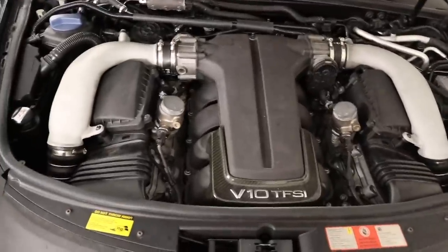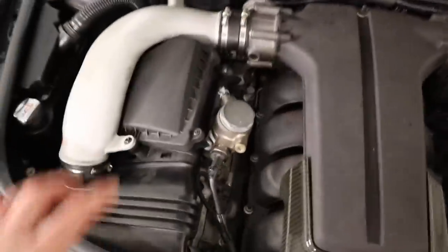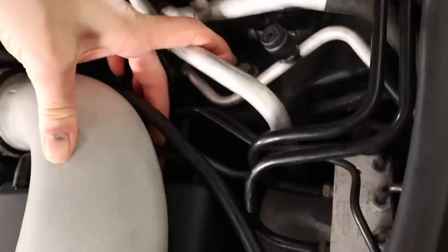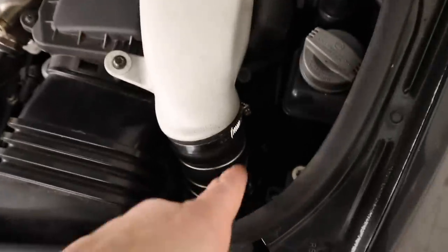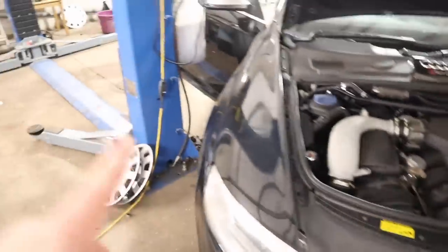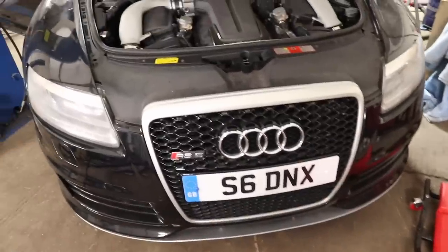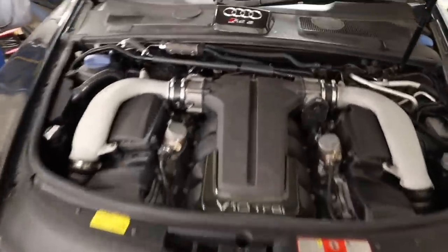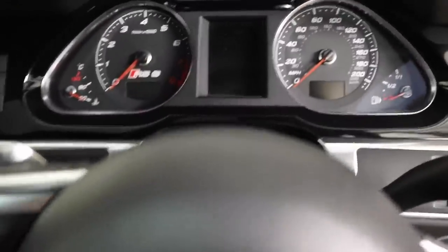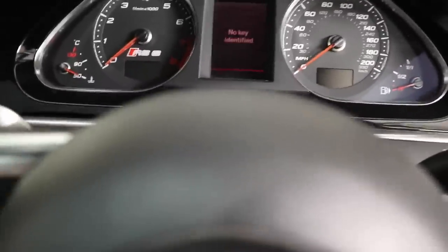That was a massive pain putting all this back together - it was a lot more fiddly. The air boxes and hard pipes are all in now. There are a couple of hoses under the hard pipe that give you no free play at all when trying to get the clips on. But we do have new hose all across the top, all five valves in position, and I've jacked the car up on this side to reattach both intercooler hoses. There is nothing now stopping me from going for a start - battery's been on charge overnight.